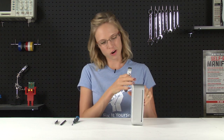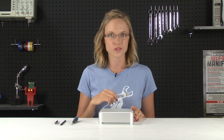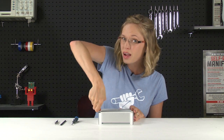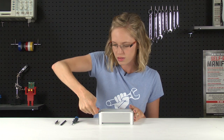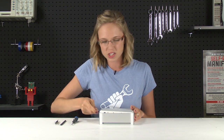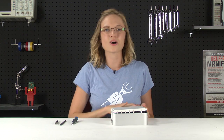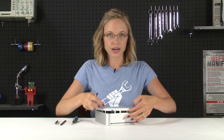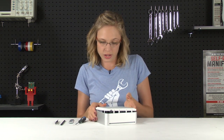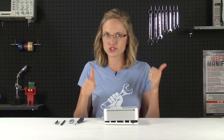To get started, I'm going to flip the Mac Mini over so that the back is facing me, and then I'm going to use my iSesamo to start prying away the aluminum case from the bottom housing. I'm going to start back near this corner, and it might require a little more force than you're comfortable with. As soon as I get that part up, I'm just going to start going around the edge and lifting the rest of the edges up.